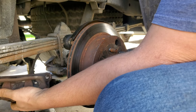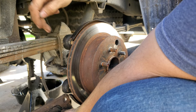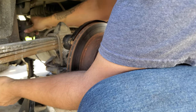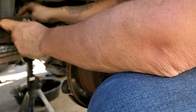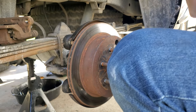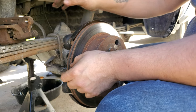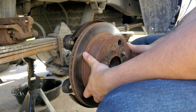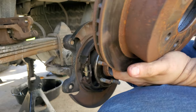These right here are going to be a little tight due to the dust shield because they kind of go under and behind it. I like to bring this one around and just set it up on the spring. You'll have to bring it under and around because it goes under the spring and not on top of it. Your rotor should just slide off like that.